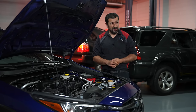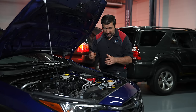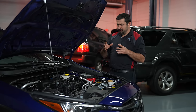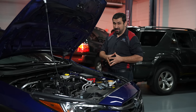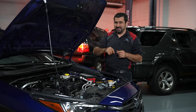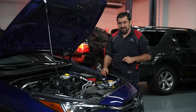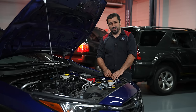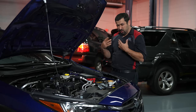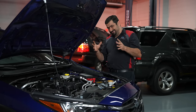Something curious: this engine does not have hydraulic lifters — it has manual valve adjustments, and the engine must come out to perform them. The setup is identical to Toyota's: a roller rocker with a shim cap sitting on the valve, available in multiple sizes for adjustment. What looks exactly like a hydraulic lifter is actually just a pivot point. They could have added hydraulic lifters with an engine revision but kept the shim design.